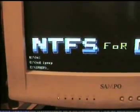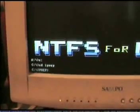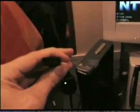We're now in the iPrep folder and at this point we are able to type in our commands. But first, we need to set up the Blaster. I purchased a power adapter on eBay — you can see the power adapter there, the cable, and on the end a Molex connector. It was very cheap. You don't have to use one of those; my PC has spare connectors which you can also use to power the Blaster.